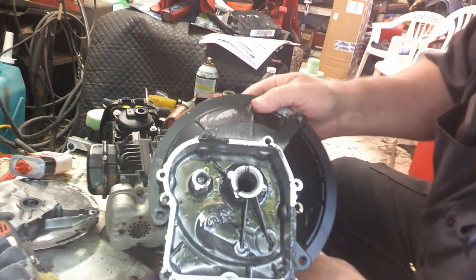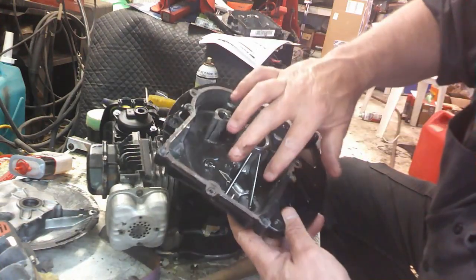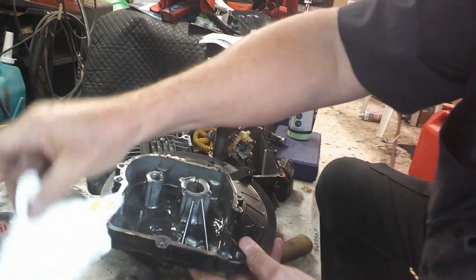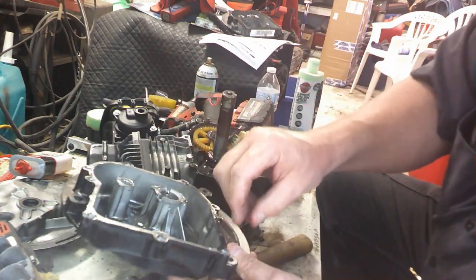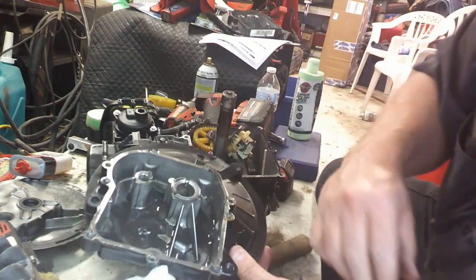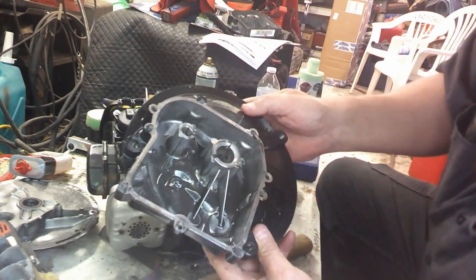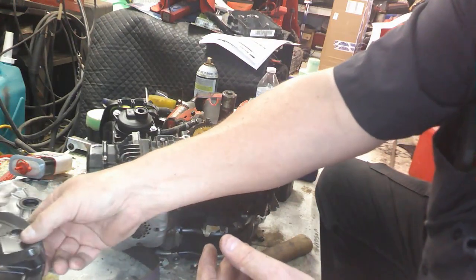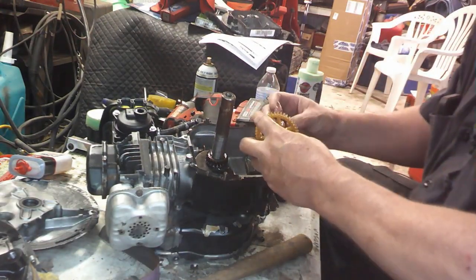There's what it looks like on the inside. That's mostly all lawnmowers. Since there's no filtration process, you'll get pieces like that. So that's why it's good to actually take these engines and drain all the oil out once in a while, and then rinse it out with something like solvent, and then continue putting better oil back in it. It'll last a little longer since there's no filter.